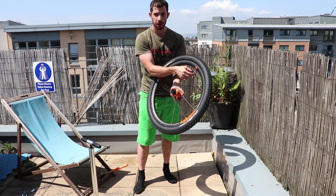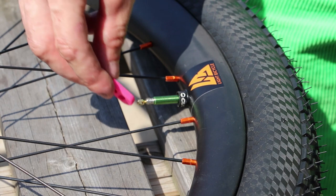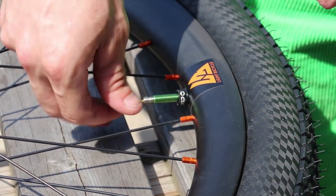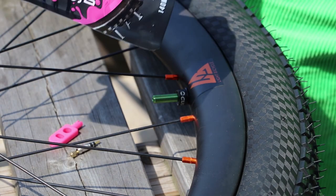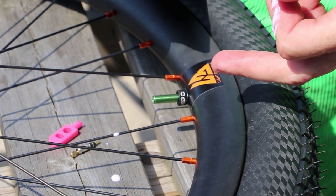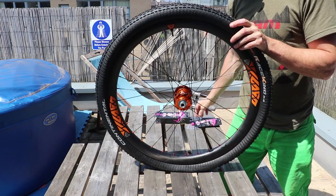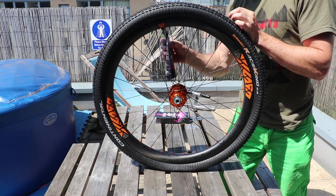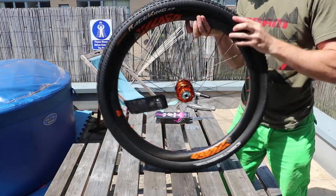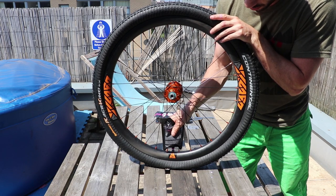The way I'm going to add the sealant is I'm just going to let all the air out. I've actually got some of the new Muc-Off tubeless sealant so I'm going to use this and see how it works. What we're going to do is use this tool to undo the valve core, and this stuff actually seems really cool in that the nozzle is a direct fit into Presta valves. So if this all goes well, this should be pretty mess-free. To do this I'm just going to stand the wheel upright, get my pouch — it just pushes on, a pretty tight fit — and then I'm going to turn the wheel the other way up and just squeeze that into the tire. I want that extra protection so I'm just going to go for the full bag.